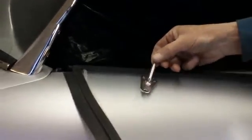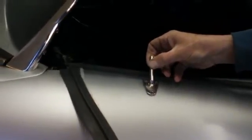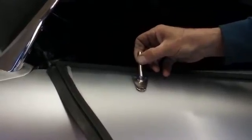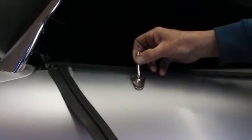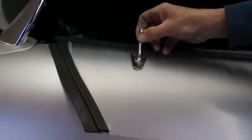So how are they attached? Well, all side curtains attach with pegs. Let's remove this one and show you how it looks when they are attached. This is a typical peg that is on all side curtains. What is the difference between this peg and the other pegs? This peg is bolted onto the plastic, whereas the other pegs on other side curtains are actually welded onto a metal frame which surrounds the side curtain and is covered in fabric. That is a much better system, but unfortunately there is no metal frame here, and the only thing you have to attach to is the plastic.